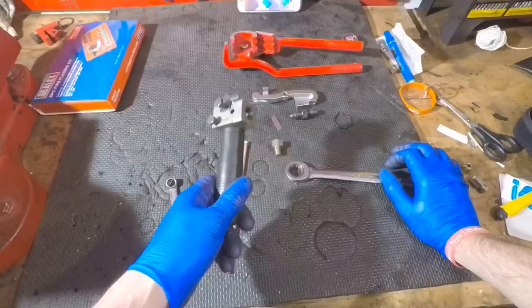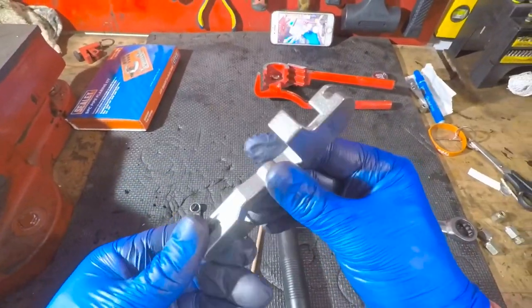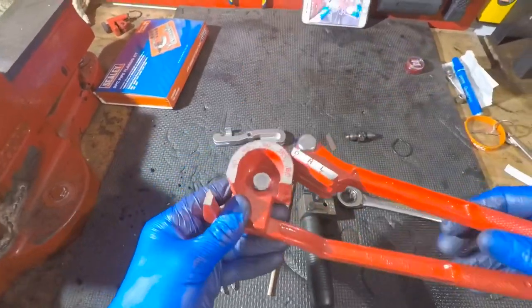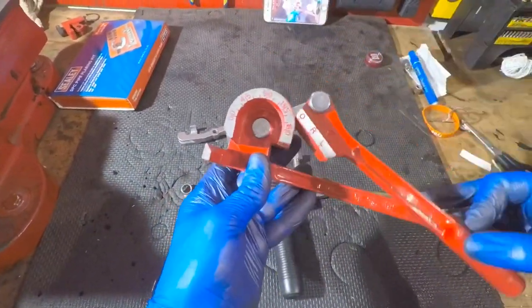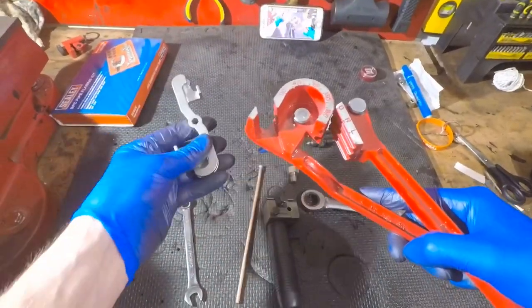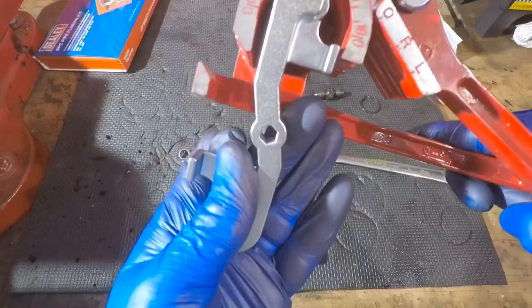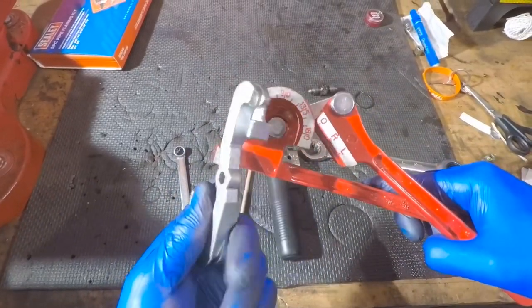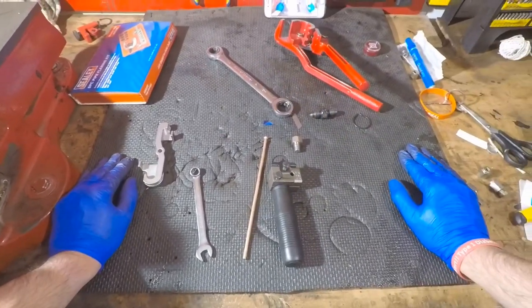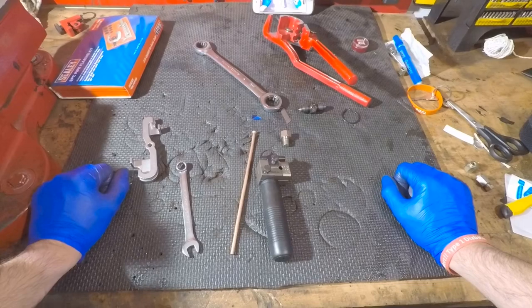To accompany these you're going to need some pipe bending tools as well. The best one you can buy is probably a nice simple one just like this — between 7 and 11 quid, and they really are good. These are obviously great as well, but you're limited to the angle you can achieve with those. If you've got a really tight angle, then you're going to need something more like this — you can see the difference in how tight you can go. So yeah, brake pipe flaring tools: leave those, buy one of these and you won't be disappointed. Perfect flares every time.